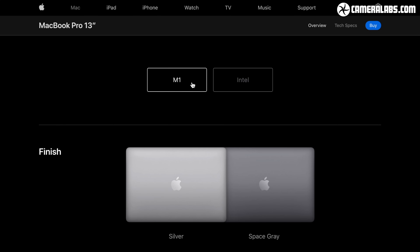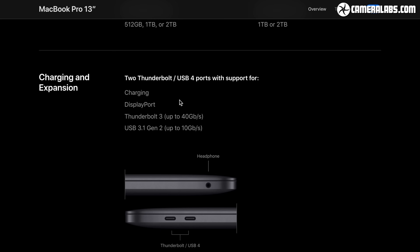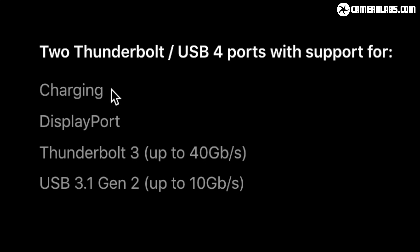But in my experience they deliver reliably faster speeds in practice with less fuss and confusion overall. The good news for Mac owners is that Thunderbolt 3 has been a standard port since late 2016, so that's the past 5 years. And if your PC doesn't have a Thunderbolt 3 port, you can add one with an expansion card for roughly the same price as a card that offers a USB 3.2 Gen 2x2 connection. Certainly easier to say, isn't it?